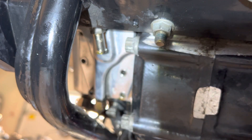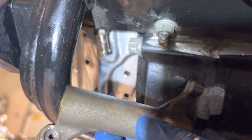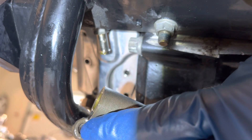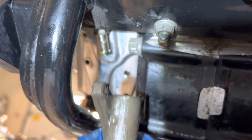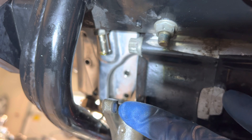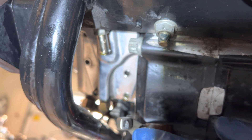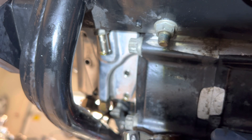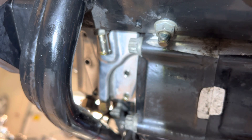Let me explain how these work for you guys that aren't familiar. This is a roller rocker on the top end. The push rod pumps oil in through there and then it shoots it out through that little hole — you see that? It squirts it on top of the valve stem. The roller rocker is pushing the valve down, but if you don't have enough lubrication there, that's going to score up. The valves were more compromised than the actual roller rocker arms. That's why I decided to take this pump out and send it to Frank so he could update it and get it lubricating correctly.